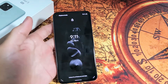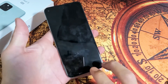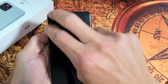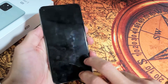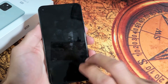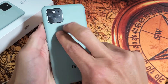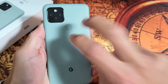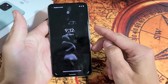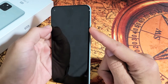After you do that, the next thing I want you to do is what I call the tapping method. Let's pretend the phone is black. Get two fingers, hold the phone, and tap kind of hard all over the screen. What happens is you might have something that's slightly disconnected or dislodged in the back, and when you do this it'll often pop back in place. Sometimes even on a black screen it'll suddenly appear, or you might get half the screen or lines. Do the same on the back — tap everywhere, even on the fingerprint sensor and the camera lens. Note: do everything at your own risk. After that, press and hold the power button until you see the Google logo appear.